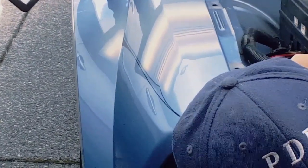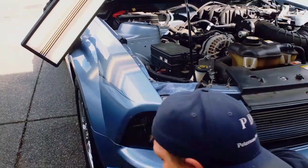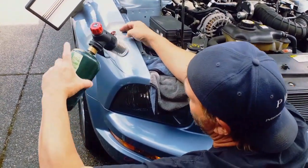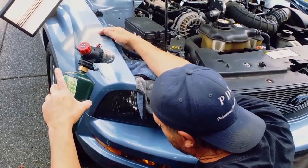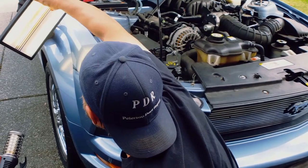This is kind of working — let's get right in here and rock this edge all the way down. I'll work the top side first because I know I can get to it, and then I might flip the tool around to get that bottom outside edge. Right on the body line — I'm just gonna lift it up real slow. These are patience pushes. The temperature isn't everything — I've done dents in the cold and had them come out well — but the temperature helps, and any time you can get an advantage to move that metal, you want to take it.